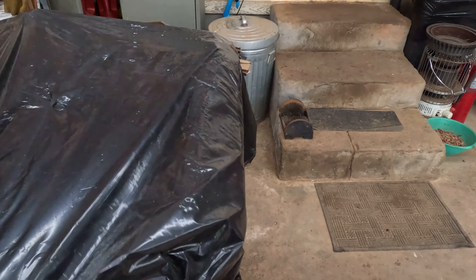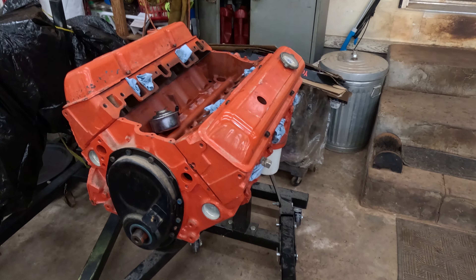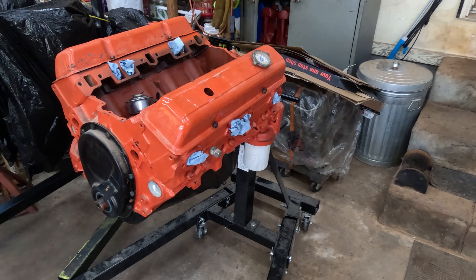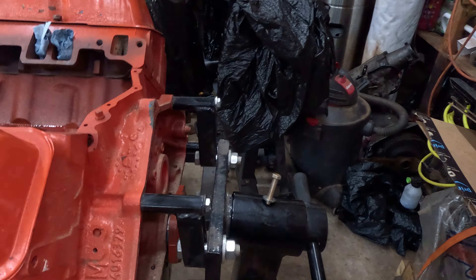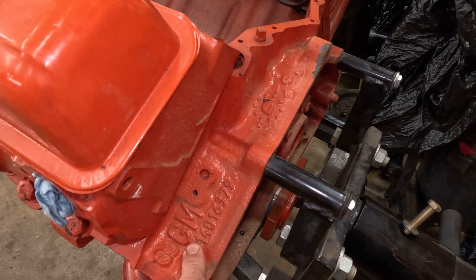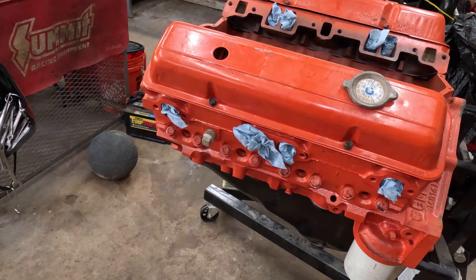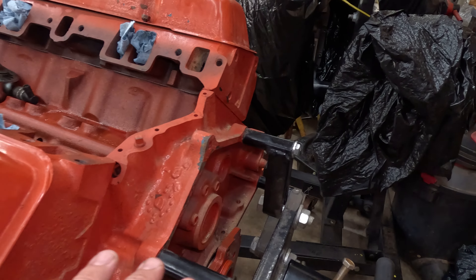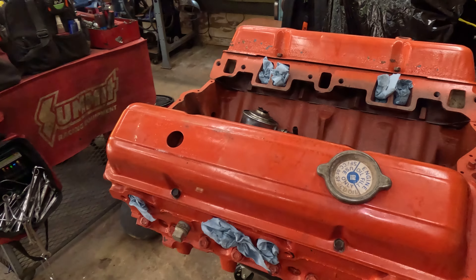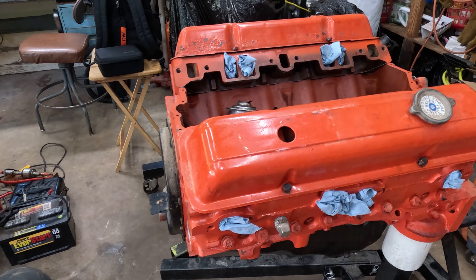This morning I really want to mess with this engine a little bit - this 350. I did put out a short trying to ask for help on this engine based off the casting numbers. This is a late 70s, like 77 through 79, 350 - so that's cool. It's a 350 two-bolt main, two-piece seal. The only thing I don't know is how good these heads are, not that it really matters. I'd just like to tell the customer slash friend what he got.